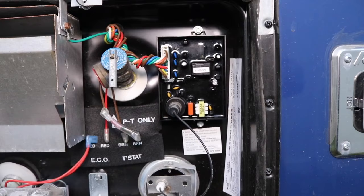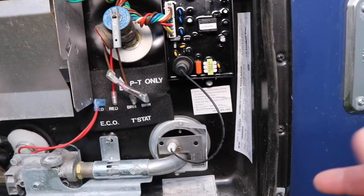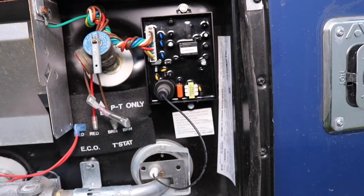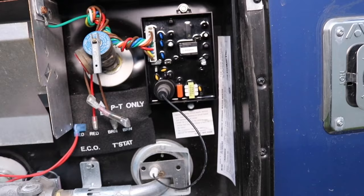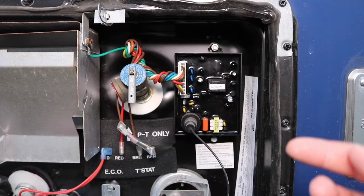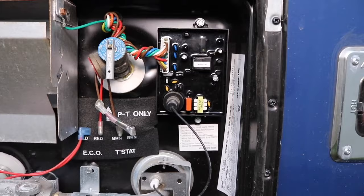Last year our water heater went out right at the beginning of one of our camping trips. It worked on 110 but it did not work on propane. We did everything we needed to do to troubleshoot — we took these off, sanded them, and tested ohms on it. It was fine. So what it was, was actually the control board. I took the control board off and took it to the dealer — they didn't have an appointment but they checked it for free. So next time you have a problem, take it off, go talk to the service guys and they can check it for free without needing to bring your whole travel trailer in and pay a service charge.